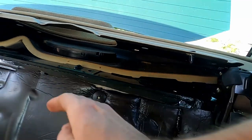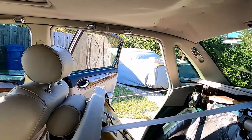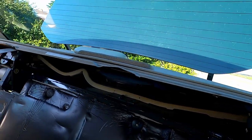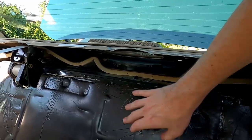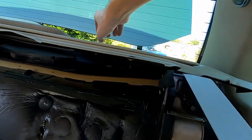I've lifted the package tray up — there are just two clips that hold the leading edge down. The proper way is to remove the inner C-pillar cover, but it appears to be a single piece all the way up to the hand hold, with a lot of plastic clips plus dome lights to deal with. Several folks online have said it's possible to bow the package tray up in the middle, effectively pulling the leading edge in and up to come over the seat belt guides. I need to keep an eye on the undermat and make sure I don't tear that up.